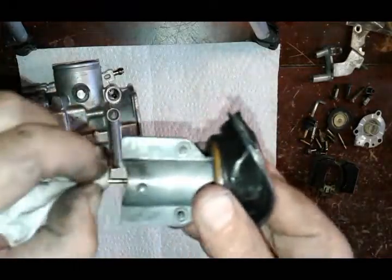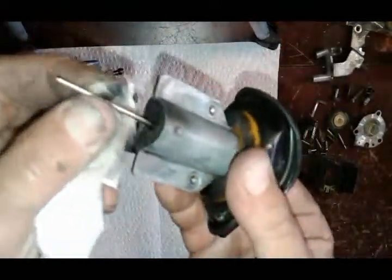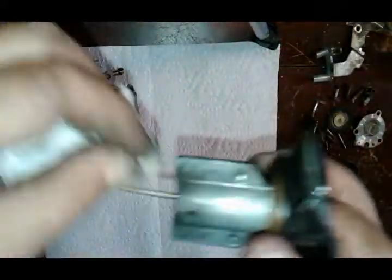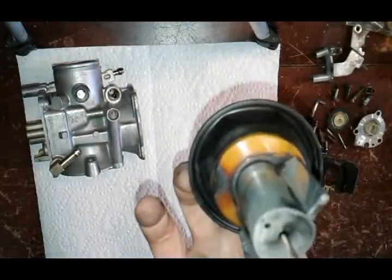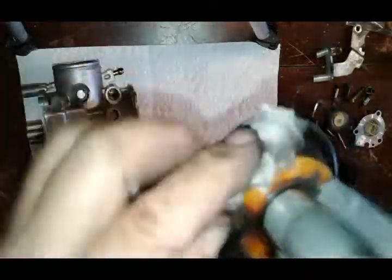Next, while we're waiting for the solution to do its job, I'm going to clean all the other parts with my spray can carburetor cleaner. Just get some on a paper towel — look how dirty that stuff is. Clean the needle — it's very important that this needle is not dirty. I don't feel the need to take the needle out of this housing since this bike was still running okay; it was mainly just leaking fuel out of the acceleration pump. But since it hasn't been open for a long time, you always want to inspect the diaphragm and make sure it's not ripped. If your bike is not running good and is surging under acceleration, there's a good chance you have a bad acceleration pump or a ripped diaphragm.